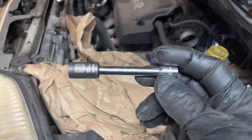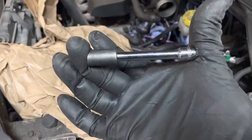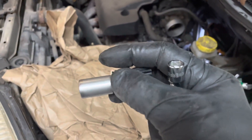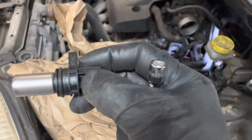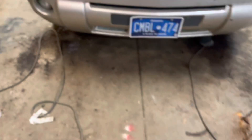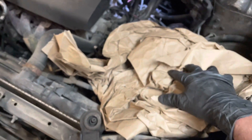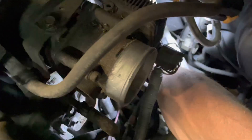This is the socket that was on it: 10mm, about three and a half inches long. Then you use a small quarter-inch drive ratchet on the end, and you should be able to back the bolt out. The sensor sits in there just by the friction on the washer. If there was a little bit of grease put on before, it should just pop out. If you can get some bent needle-nose in there, it'll pull straight out. There's no point filming it — it's just a bunch of me reaching down in the engine. Essentially, put your knee on the battery with some padding and put your hand down between the hose and this — you can usually get around it, sometimes going around the backside of the hose. You cannot get this from the bottom.